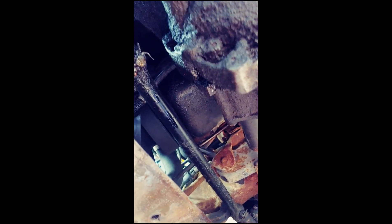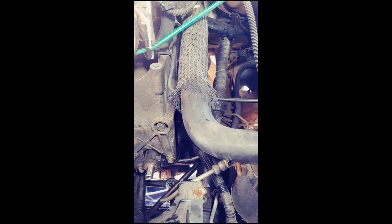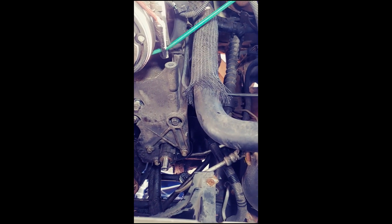All I'm going to do is tighten this one up and tighten the one that attaches to the frame of the car. Easy peasy. Clean the threads and do it finger tight as much as you can before you put the wrench on it, to eliminate any cross-threading.